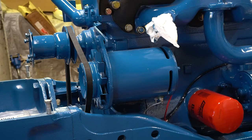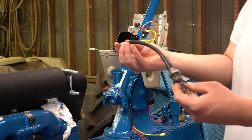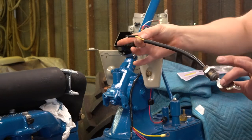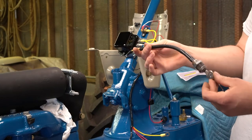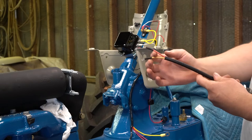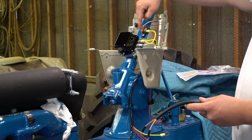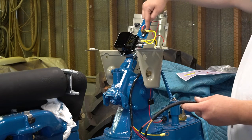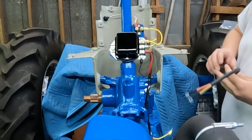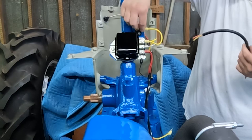My next step is going to be putting the dash, throttle, and the battery tray in here. So on our ignition switch — which on a diesel tractor — we have two wires: one red, one yellow. Up here on top where our main harness is, yellow to yellow, red to red. This is why I left this loose, because there are even going to be a couple more wires that come up here.